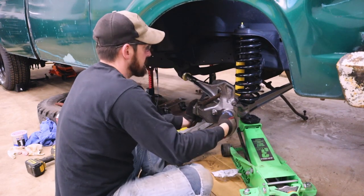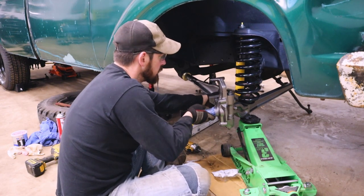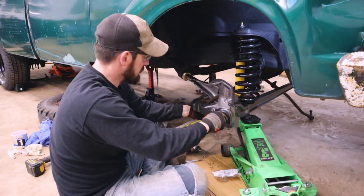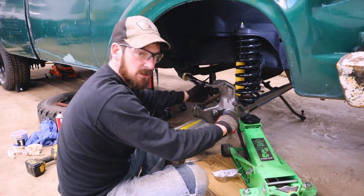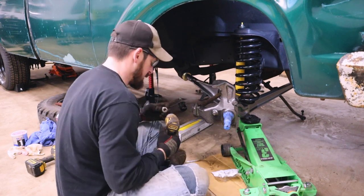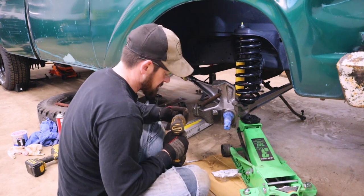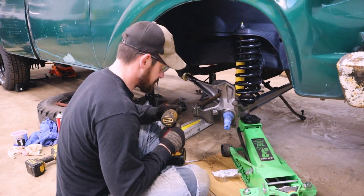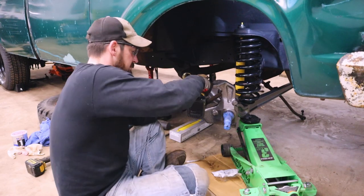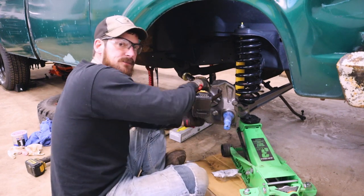The diameter of the hole and the ball joint are the same so I don't have an issue there. You just get this pushed down right, the arm right, and the ball joint twisted and then it goes in. I twisted the steering back and forth and we have no binding. It hits the bump stop but does not hit the shock, and then we come all the way out with no binding on the arm. There are some minor differences between this one and the '66 but it goes together.